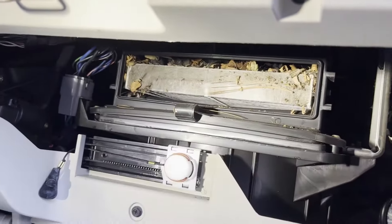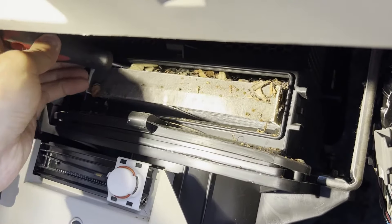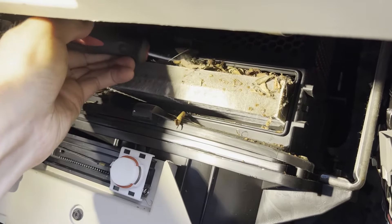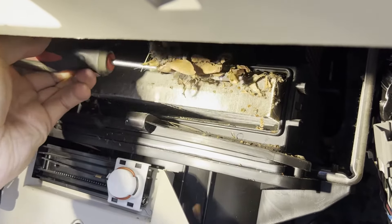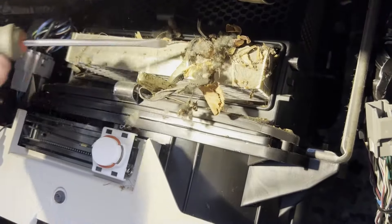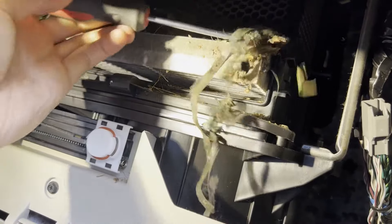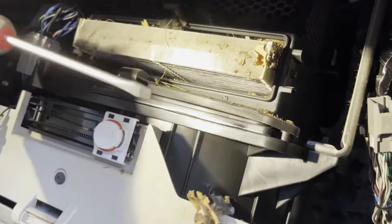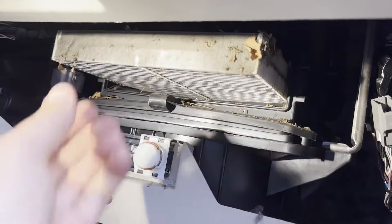This cabin air filter has not been changed in a long time and was very dirty. There was so much buildup on top, I used a screwdriver first to try to get some of this buildup out of the way, because I didn't want any of this stuff falling into the blower motor that's below this filter. I tried to get some of this top debris out of the way before actually pulling out the filter. You can also utilize the same flathead screwdriver to get a better grip on the filter by sliding it to the bottom and then pulling it out. Then you should be able to pull out your old cabin air filter.